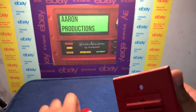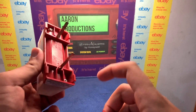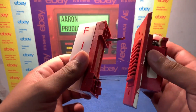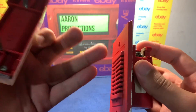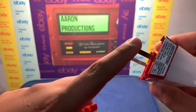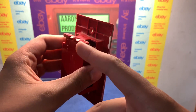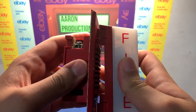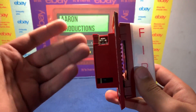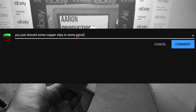Usually I'll put up a picture of one I found online — normally this would be able to clip right in. They do sell the model that would go with this. One thing to note is that the red striped part at the top of the device must go into the top of the mini horn, as you can see the two terminals are at the top. This is where the positive is connected, so this is polarity sensitive, and that's how it's properly installed.